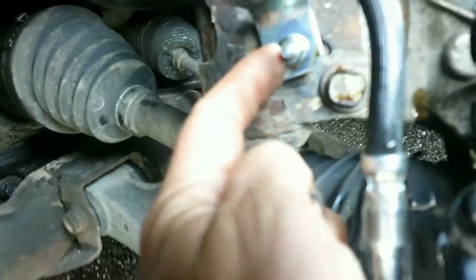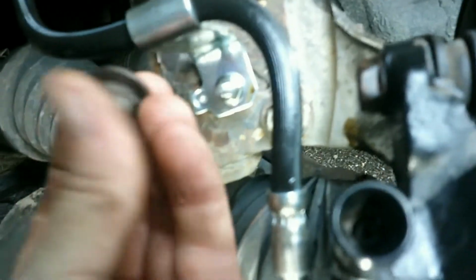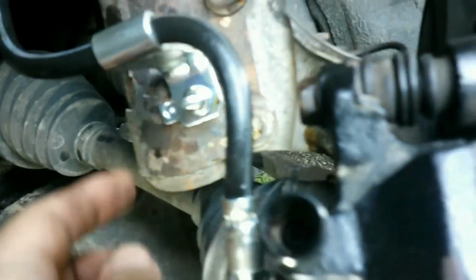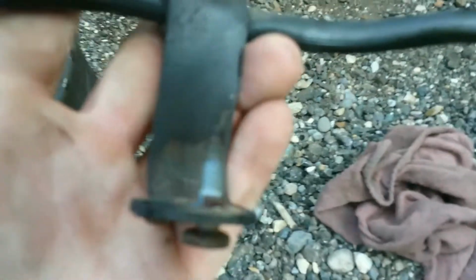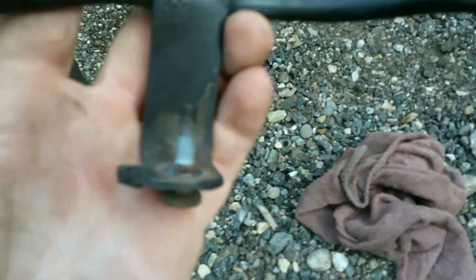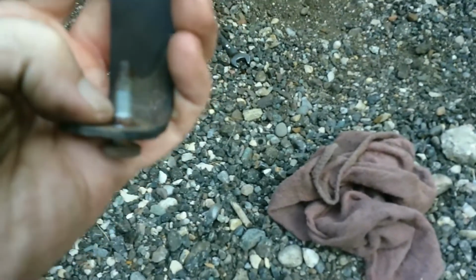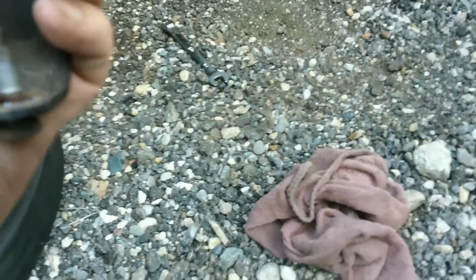We stripped this bolt because it's supposed to be hollow on the inside. So make sure you reuse your old bolt and you won't make the same mistake we did. So that's not going to collapse down over these grooves, as you can see. If my camera would focus. My screen's pretty small, but there's grooves here. And once we pulled that bolt to those grooves, it stripped.